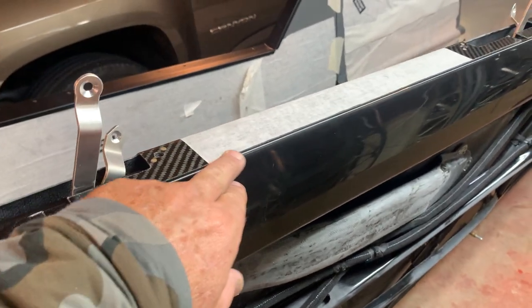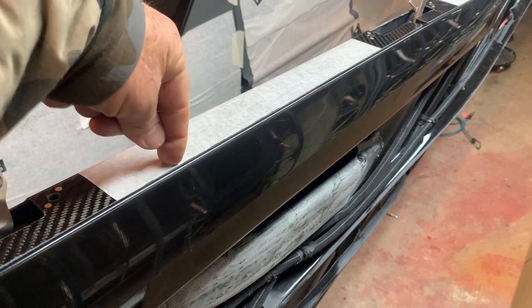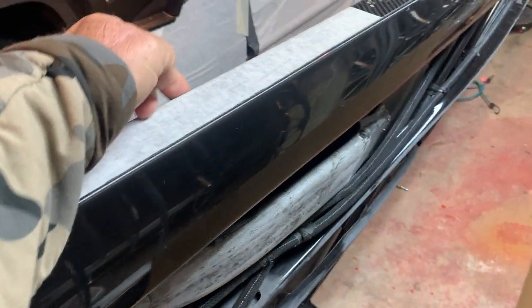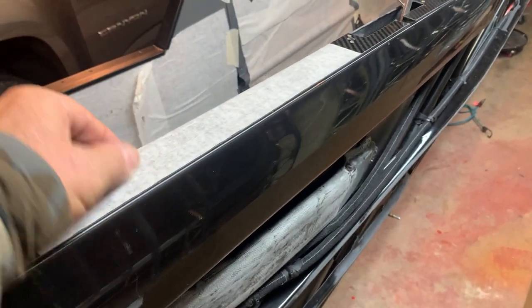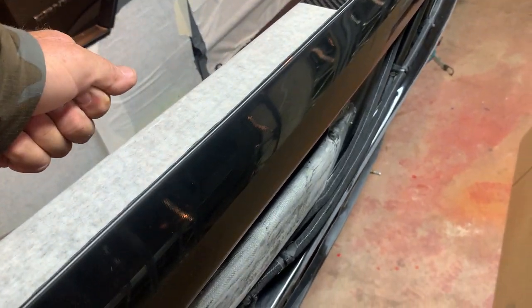And there's no reason to do it, because the fabric is going to come up, wrap, and then you can glue it solid to the top of the window frame here, and then we're going to wrap it over. You can razor it off if you want to, but I'll just go ahead and bring it back over a half inch underneath there even. And I just pull it as I do it. I'll just pull the fabric over.